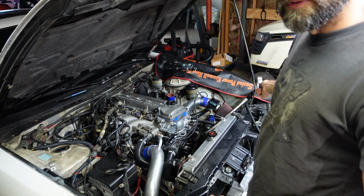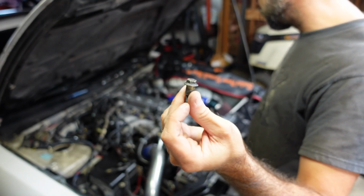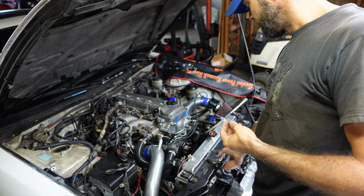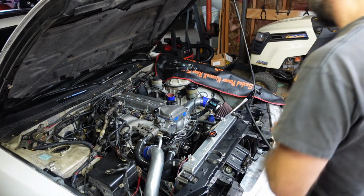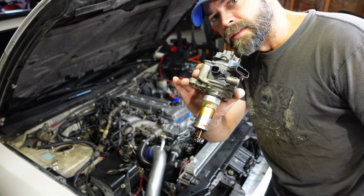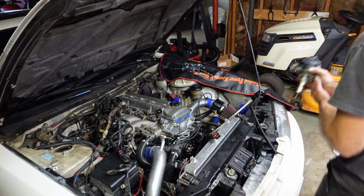So I'm going to get that intercooler pipe back on. I'm going to get this bolt put in the back of the valve cover back there. Get the valve cover torqued down to spec in order. And we'll get the charge pipes put back on, get the distributor stuck back in, and we should be good to go. Time to finagle the distributor back in there. See if we can get it clocked back right. Get a start up first time on this one.